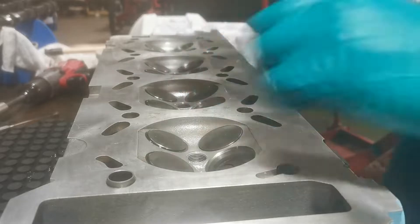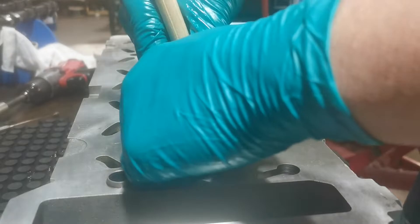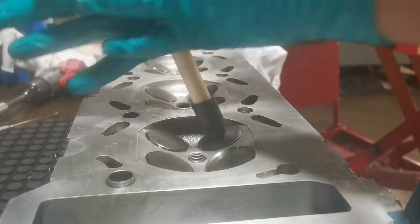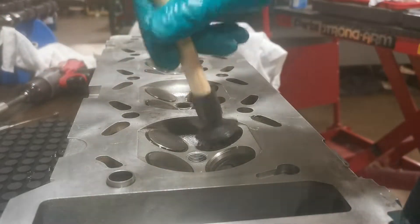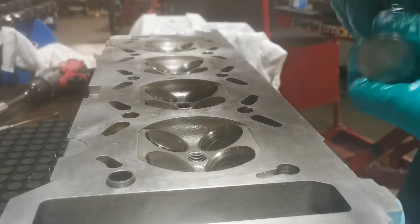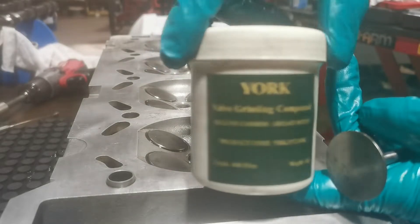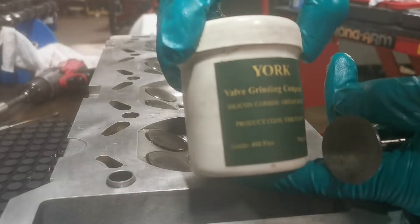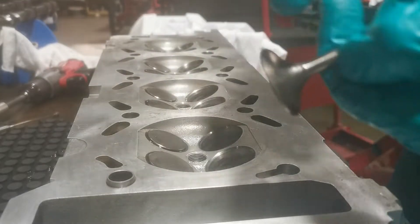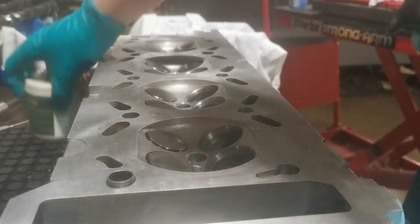Because there's nothing to say that perfect contact is being made all the way around. So what you need to do is get yourself a tool like this - just one minute without putting any pressure on and just spin like so. But you need grinding compound in between the two - I've got this fine grinding compound here, not sponsored, which I'll put in between on the face and just polish away.